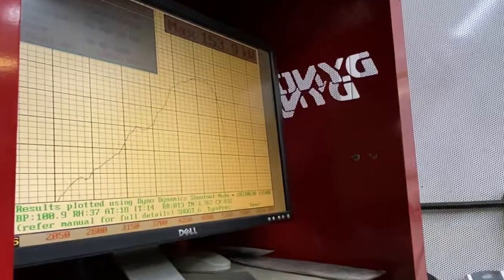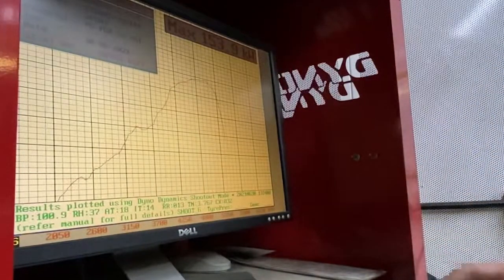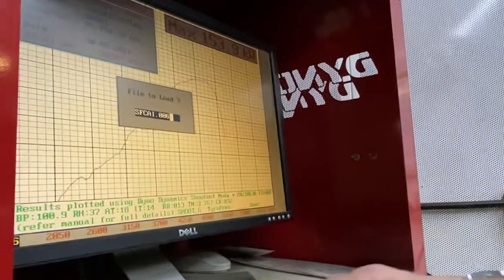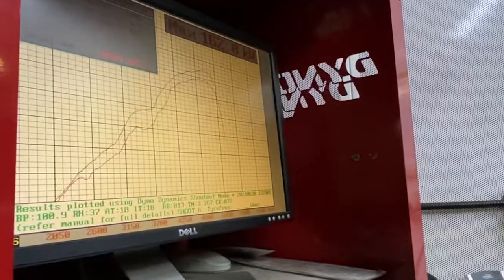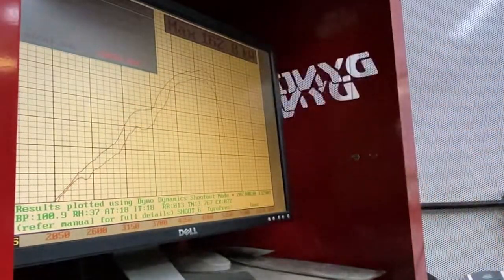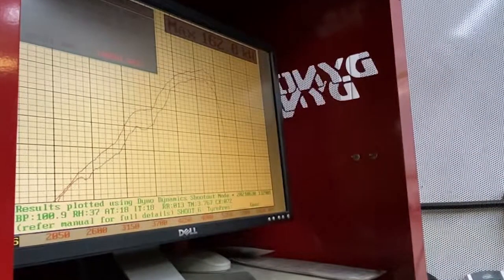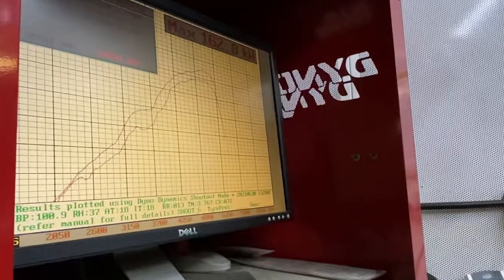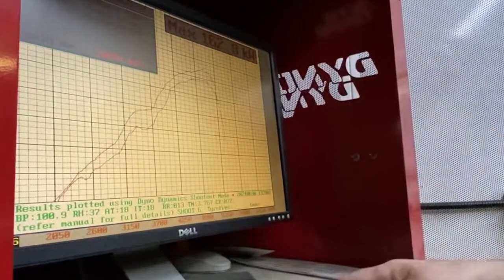That's your standard airbox. Then we did three runs with the full cover airbox. So we started from six. Okay, so immediately from 154 to 162.8, someone worked that out for me. That's 6.2, that's 8, almost 9 kilowatt increase just from fitting the full cover Street Fighter airbox. Once again, remember we do three runs for stabilization.